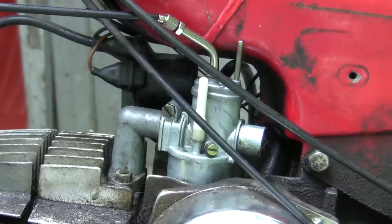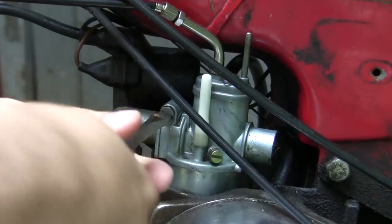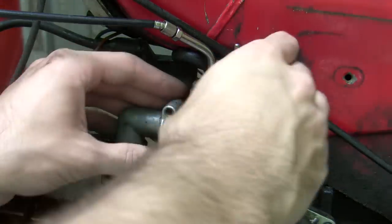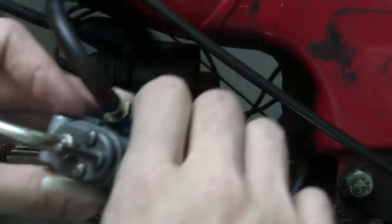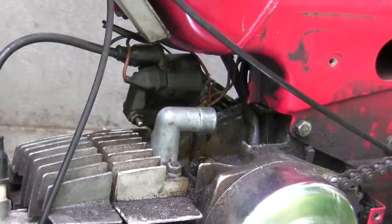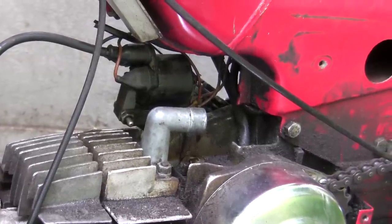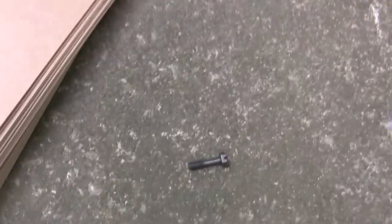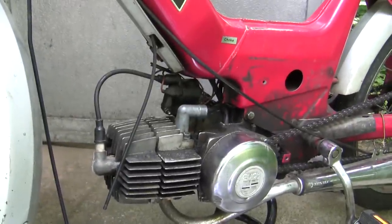Next, the carburetor's gonna come off. This is just this one screw right here. Then you just turn and wiggle, and that's off. It's also worth mentioning that after you take each part off — and this is especially helpful if you're just starting out — you should bag and label each part. It's nice if you have plastic bags, but I just have paper bags today. So the carb screw goes in a bag, which then goes inside a box, so that when you go to put this back together it doesn't get mixed up with any of the other projects.